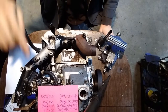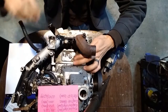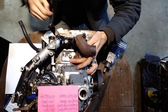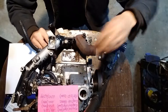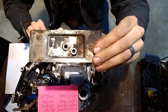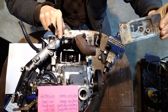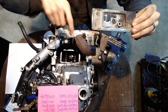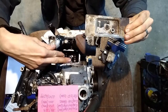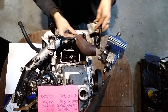I pulled off the valve cover on the opposite side and checked the clearances there. Now I'm doing the same over here. This valve cover has a 7/16 head on the nut and a copper washer; it slides out. The opposite side is a little harder to get out because I still have the exhaust and intake on — it's a little tricky getting it out of there, but doable.